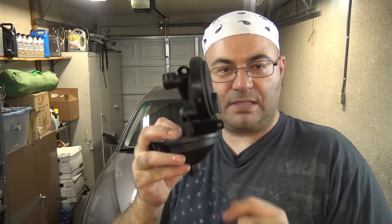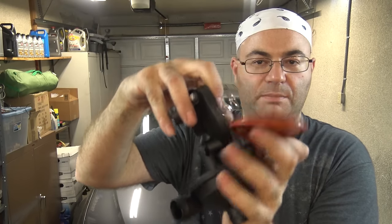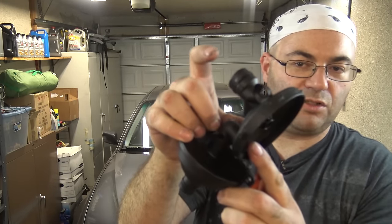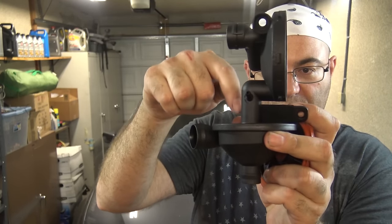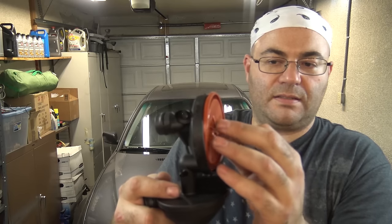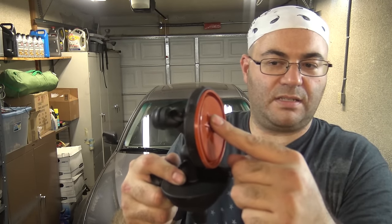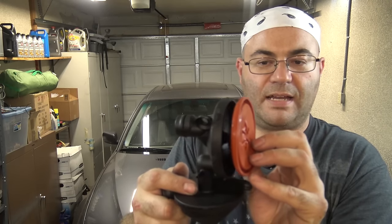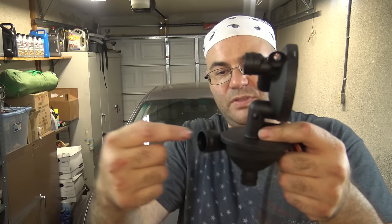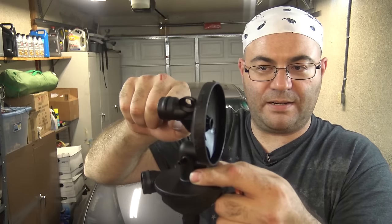Let's take the cover off and see what that diaphragm looks like. I've just removed this cover right here. As you can see, there's a diaphragm inside with a spring inside there. There's a sealing surface on the inside of the diaphragm. There's a hole right here that connects to this tube down here, and a hole that goes down to this tube — this is the second chamber where oil drains down to the oil pan. This diaphragm looks like it wants to seal with that sealing surface in the center, but the spring is pushing back against that, holding it open just slightly — just enough to create a little bit of vacuum, not enough to suck all the oil up through here, but enough to suck the crankcase vapors through here and up into the intake manifold.